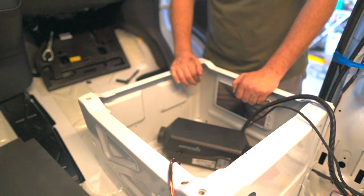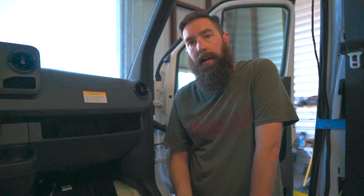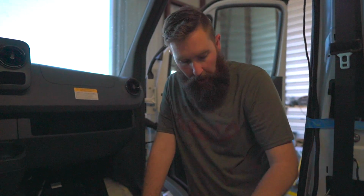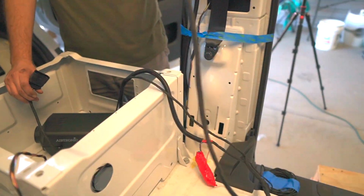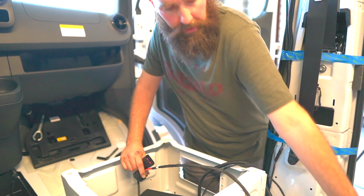That just goes down, simple as that. I'm going to go underneath it and put lock washers and the nuts provided on the bottom to hold that. Then we're going to connect up our wiring harness, which is here. So everything will be connected underneath the seat. Then we're going to run fuel line.